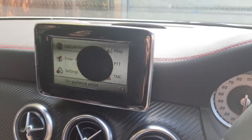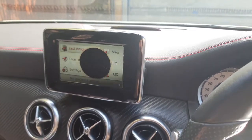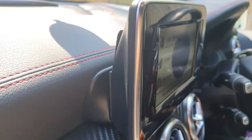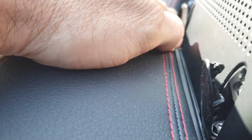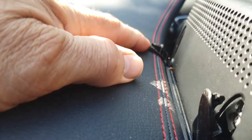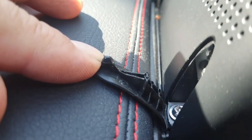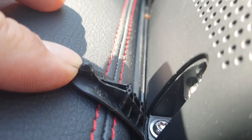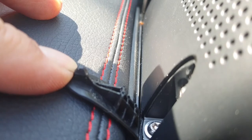If not, I'm going to take this one off, find out the exact model number, and obviously replace it. To access the two screws, you've got this rubber here — you just need to get a flat head screwdriver and pull them out each side. Don't lift them right up otherwise you'll break them, because they've got a little O-ring type situation at the bottom. You need to get the screw out first — I think it's a T20 Torx.